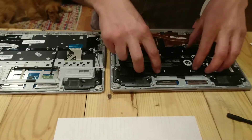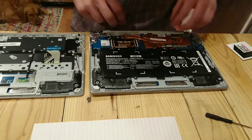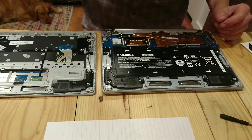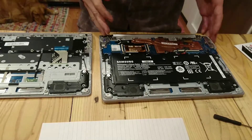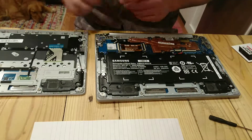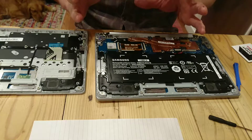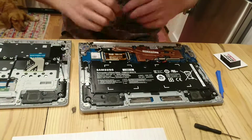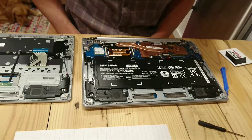So I'm going to have to remove the battery and the motherboard and just move them onto this one. I'll probably get this removed from the computer before I take these apart, and then put them on here. Another good thing to do is get rid of any static — touch some metal if you can before you do this, because static buildup can damage some of your electronic components.